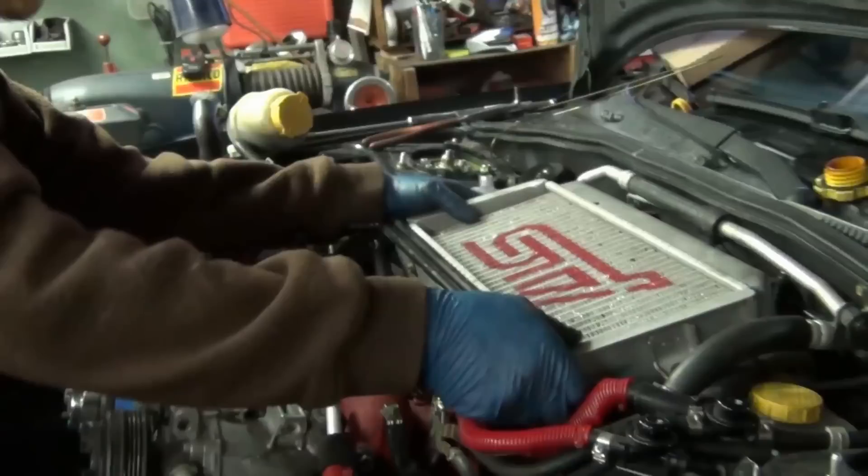This doesn't look too bad — this is manageable. Speaking of mistakes, the bracket on this particular year/make/model is a little different — you do have to take the bolts out from underneath and they are a little difficult. What I've chosen to do is use an extension and go in from behind — that way my air tools still get to be the air tool, I don't have to tediously do it by hand. I'll use a long one with a wobble on the end. Remember, wobbles are rounded — that enables the socket to pivot just a little bit, which is pretty valuable when you're dealing in tight spaces. They're 14s by the way — I should know that, but I'm not going to beat myself up.